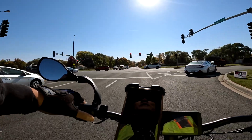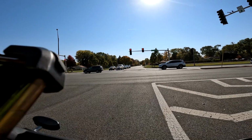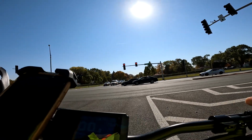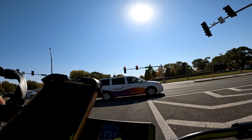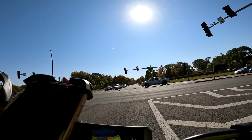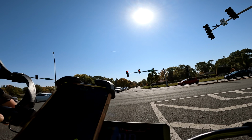So that's what I want to say about the chargers. I think you should use the slower chargers if you have an option, the ones with the lower amperage rating. Like if you have a 4 amp option or a 2 amp option, take the 2 amp option. It's going to take longer, but it'll be a little safer for your batteries.